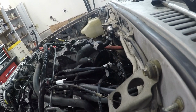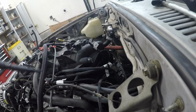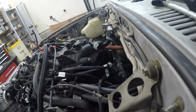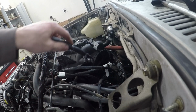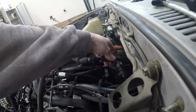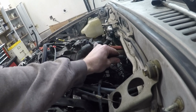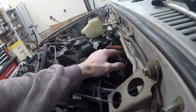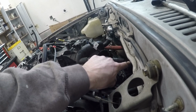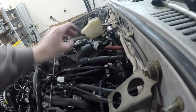All right, so same area, different piece that we're working on now. After getting all this wiring done, I think it's all ready other than this oil pressure sensor. I'm going to start sticking some vacuum lines in there. This truck's manifold apparently has this spot right here where you can take the plug out and stick in this fitting. Hopefully that's sealed enough. Now I'm going to run a 3/8 line from here to the brake booster, which is sitting right under the camera, and then a 1/4 inch line from this T down to the transmission. So hopefully the transmission will shift.